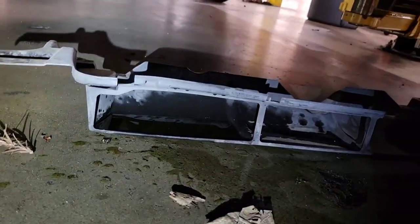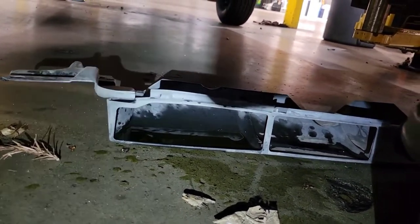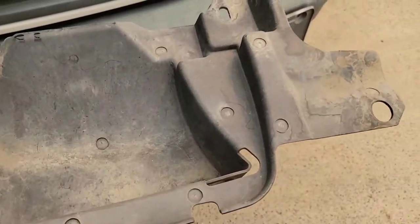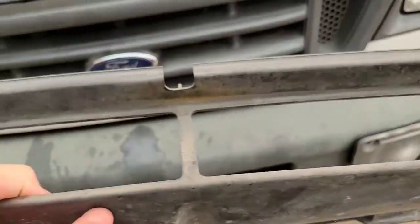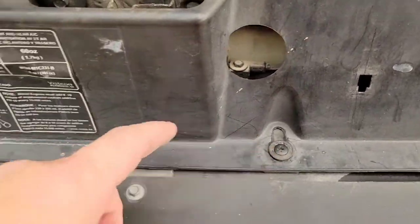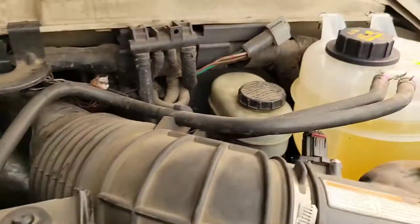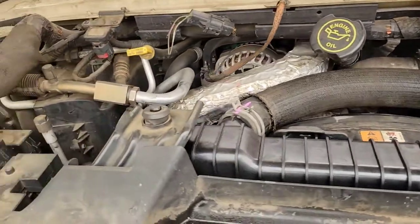There's also a plastic air deflector that goes up underneath with two push-pin clips on each side — that's it from underneath. Here's what that plastic cover looks like: it goes in like this, two clips on each side. There's also this upper plastic piece with some clips — usually not all there, so you'll typically have around five or six. The only other thing is make sure you use the airlift tool to fill it up, turn the heater on, make sure it blows hot, and you're good to go.